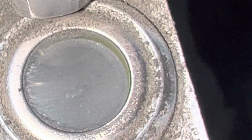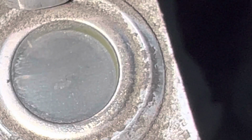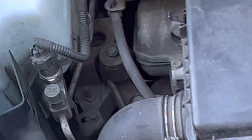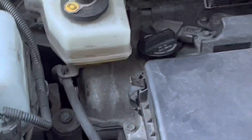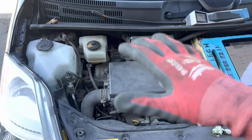But if you look real carefully, there look to be little tiny particles or bits on the inside of the glass. Well, where do particles come from? Particles usually come from the compressor. Where does all that darkness and blackness come from? That usually comes from running it low on refrigerant